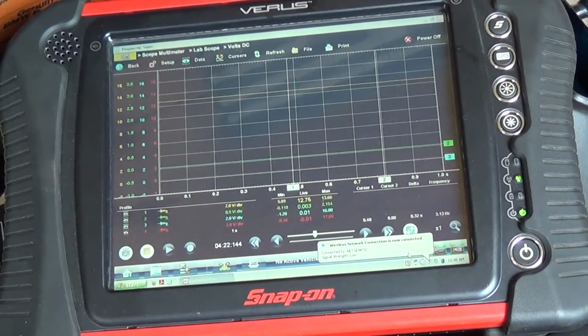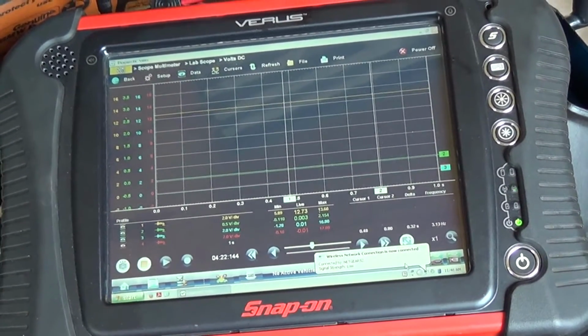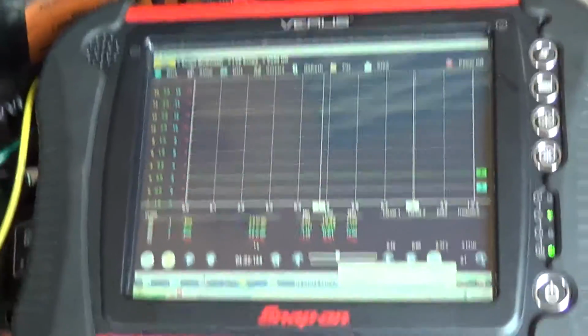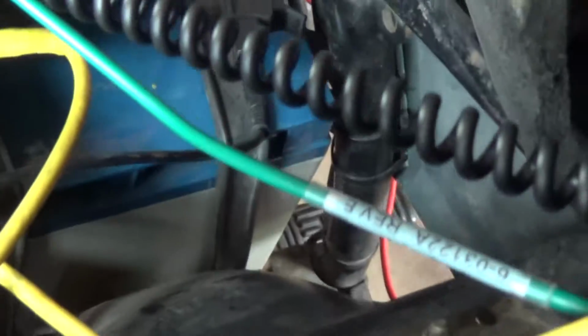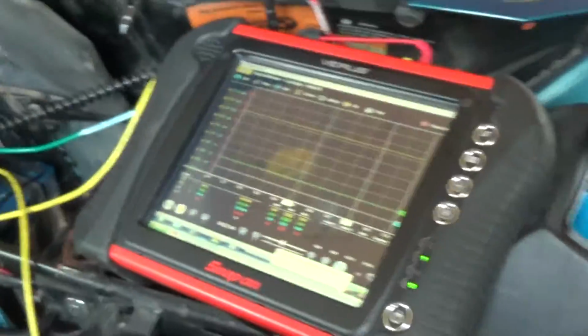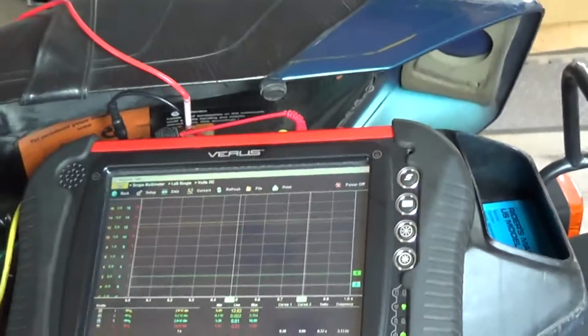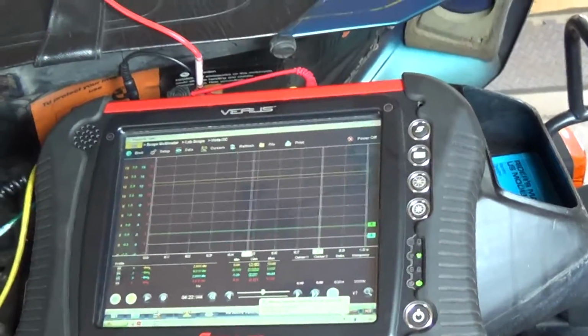So we might have to tweak that little screw on the regulator to up the voltage a little more, since the battery in this thing is actually not an old lead acid, it's just a sealed type, and you can charge these a little higher without boiling them. So yeah, we're basically done here. So let me just do a final tweak and I'll get you a final shot.